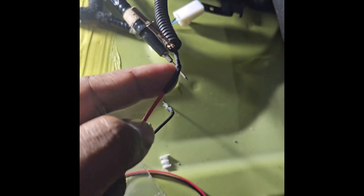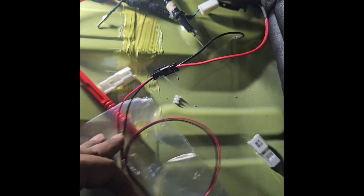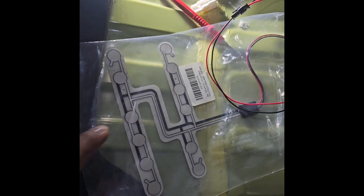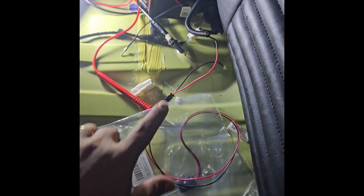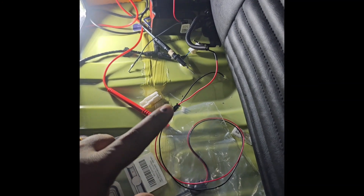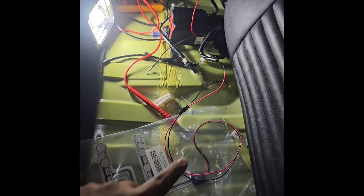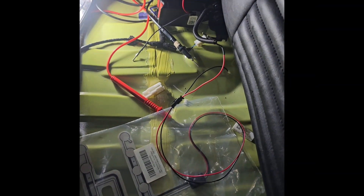Remove one of the pins, connected into an extension cable, which gets into a pressure sensor. So basically what happens is: when someone sits on the seat, this gets pressed, the circuit gets closed, and there is a beep so that the seatbelt reminder activates. In case nobody is available in the back seat, the pressure sensor is not depressed, so there is no circuit closure and there won't be any alarm in the front.